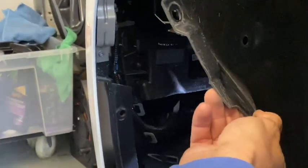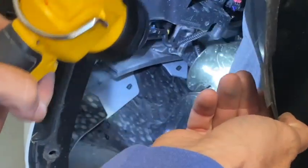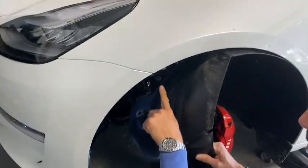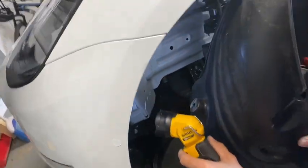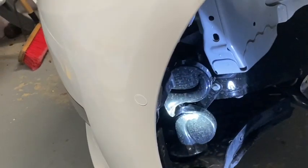Here's the actual clip for the wiring - let me unclip that. The horns are right there - you see these two are the horns. You can get this black piece out of the way by undoing some of the clips on top. Samuel, take a look inside here - this is the inside and here is the fog light assembly. I believe we need a T25 to unscrew it, and there are three screws.